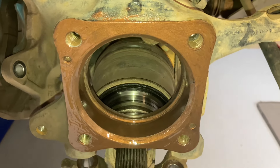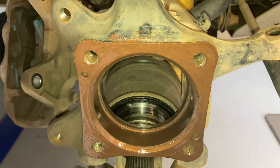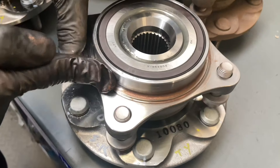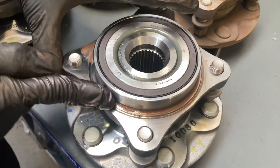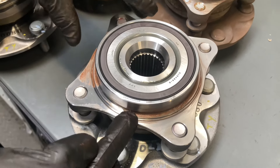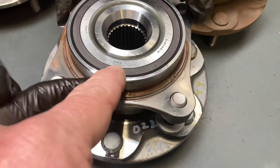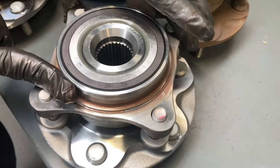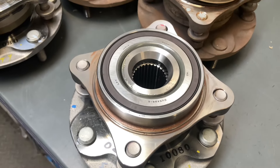So subscribe and turn the bell on so you can learn the upgrades. I hope you learned something — hit the like button if you did. People want to see how to pull it apart and put it back together, but I purposely didn't do that because we've got a whole playlist — hubs, bearings, whatever it's called — and all that information is already in previous videos. This is your ABS sensor area here — we want to make sure that's all nice and clean. Keep grease minimal around the back and on the side, just putting some into that corner there. Beautifully done.